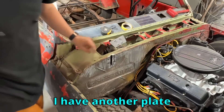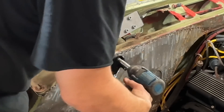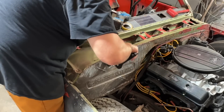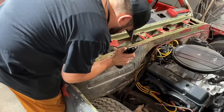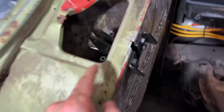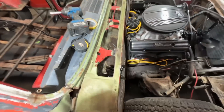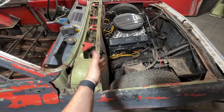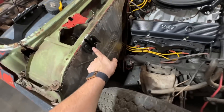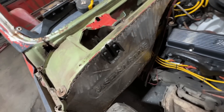I forgot I had another plate that goes out here too. It not only bolts here, it bolts in there from the bottom, so it actually ties into the inner tray. I was worried about having all the weight on this firewall especially considering how rusty everything was, but it actually bites in down there too - pretty nice. I need to trim that just a little bit - I'm going to grind it. Maybe I pulled it in when I bolted it in, but I doubt it.